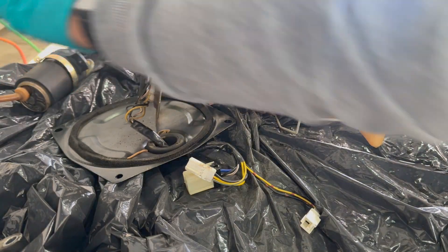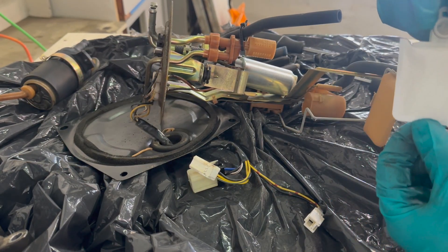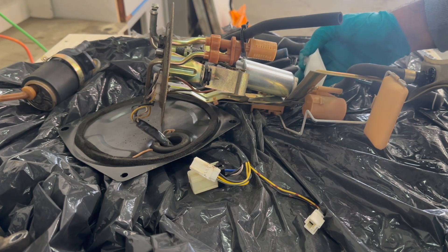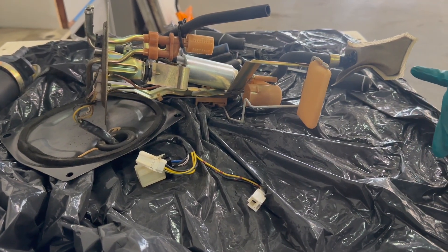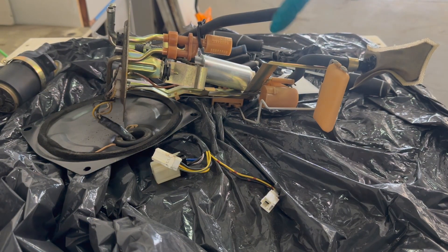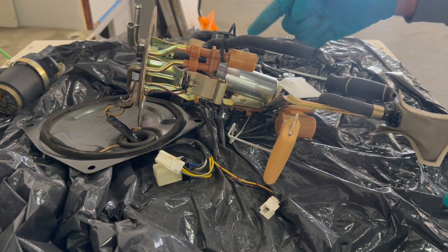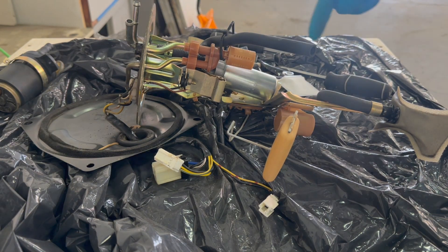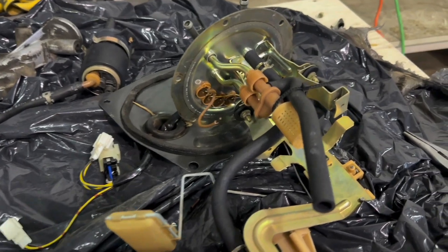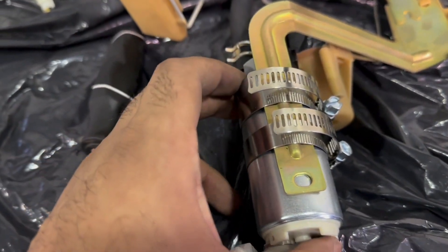Small problem — I sent a picture to my buddy because I was asking him where the sock goes. The way it's made with the Walbro it mounts at the bottom, but the sock on the old pump is all the way at the bottom of the assembly, so that's going to be at two different heights, which is obviously not good. He said the pump needs to be mounted down here with the sock right on it, but the hose that came with the kit is too short for that. Luckily the auto parts store down the street was still open — I ran over and grabbed some new fuel hose and hose clamps.